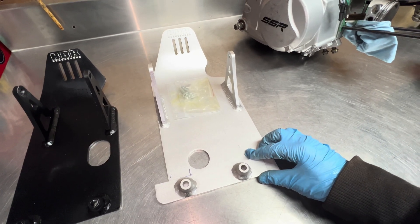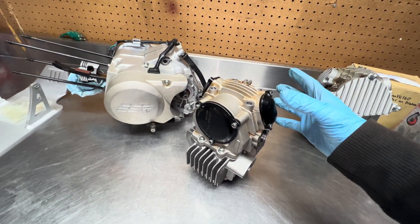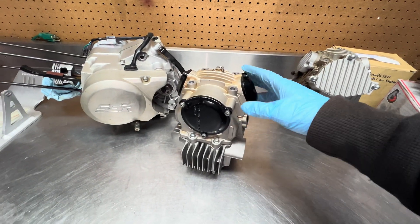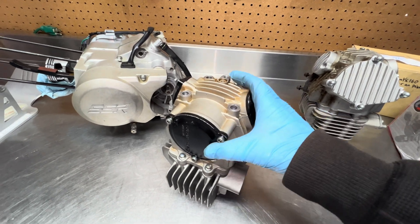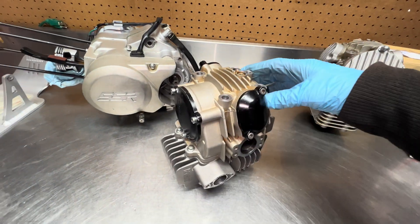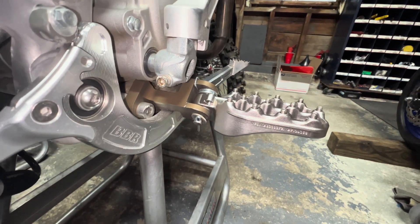I'm not fully decided but I came up with one thing today which was cool. If I am going with the bigger bore and I don't go with the 116cc with the KLX cylinder, then what I'll end up doing is just running this cylinder — still running this head on the KLX 53 millimeter cylinder and piston. If not, maybe run this one. I can do the high compression Wiseco piston and that might be better to have the bigger ports in there, so we'll see.